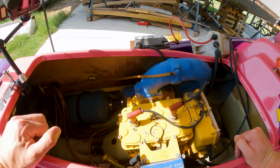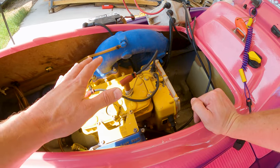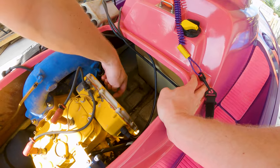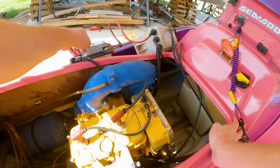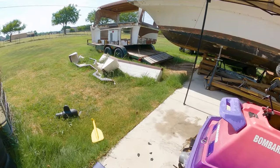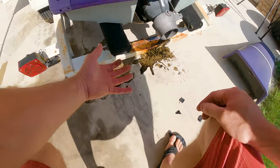First try! It started on the first try. It's idling on its own — look at that! It runs. Two-strokes are awesome. It started to run on its own fuel. That old fuel sounded kind of crappy but it ran — that is awesome. It's got no oil so I don't want to run it too much, but that's pretty good. I'm going to get the multimeter out, hook it up, see if it makes any voltage. There's a little rotor and stator in there that makes just a little electricity to charge the battery. There was some water still in the exhaust — straight two-stroke oil, that's good.